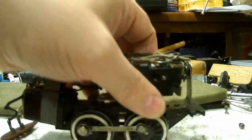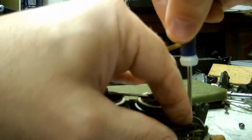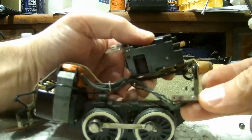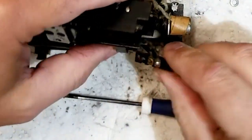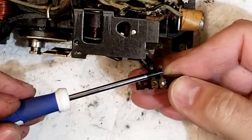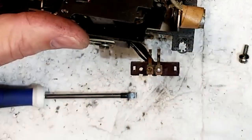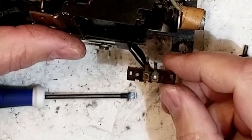Now that I've got these loose, I'm going to take my screwdriver and gently pry behind on each side. The reason you want to pry on each side is so that if you're lucky enough to get this finger assembly off squarely, you have the chance of putting it back on again. As I look at these fingers, this one actually has a hole in it and that one is pretty thin. The choice is to either put a little dab of solder in here to fill that hole — in theory it would be good as new — or replace it. I oftentimes come back to the point of saying let's just replace them instead of messing with them.